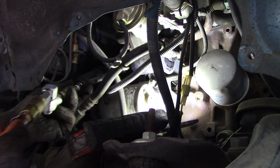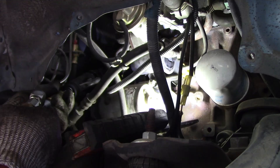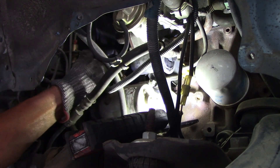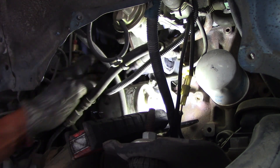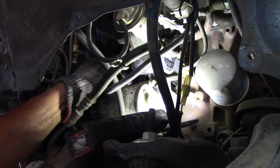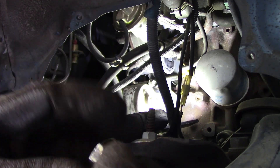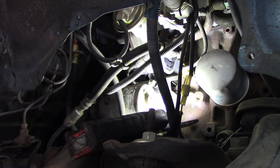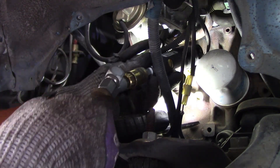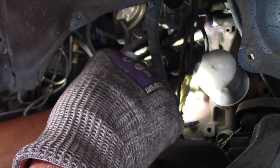Okay, let me ring it on the one in the back — fits perfect in there. Good, and you can see it came right out. Make sure to catch any washers that come out. Here are the washers — keep them safe. If you don't have an air tool, you can spin it by hand, it just takes more time. Here's the back bolt — the line out from the filter. Set it aside, and now for the front line bolt — make sure when the tool is spinning there are no electrical wires in the way.